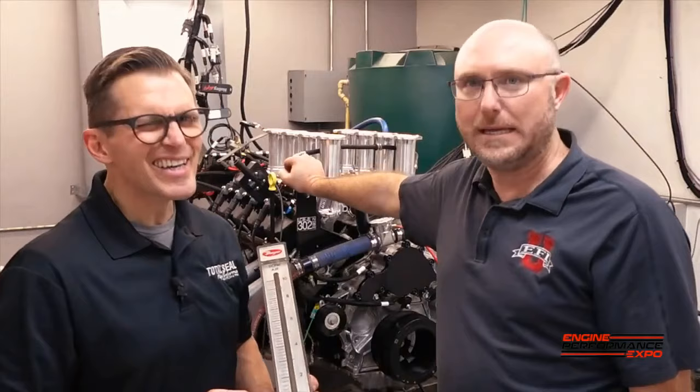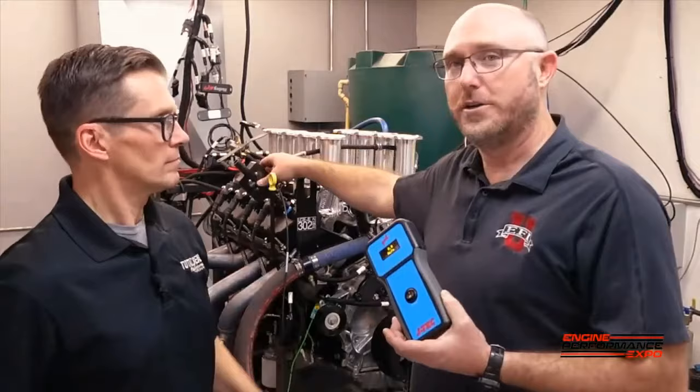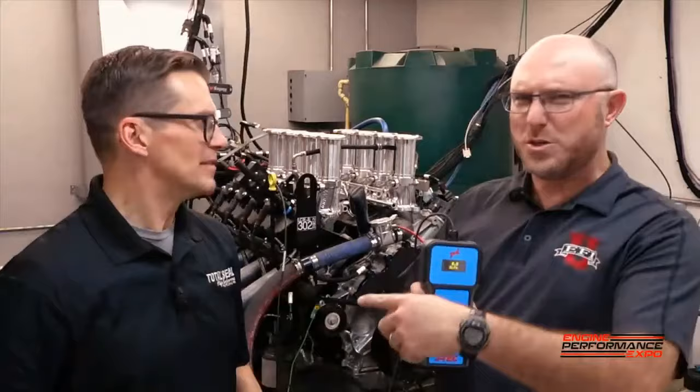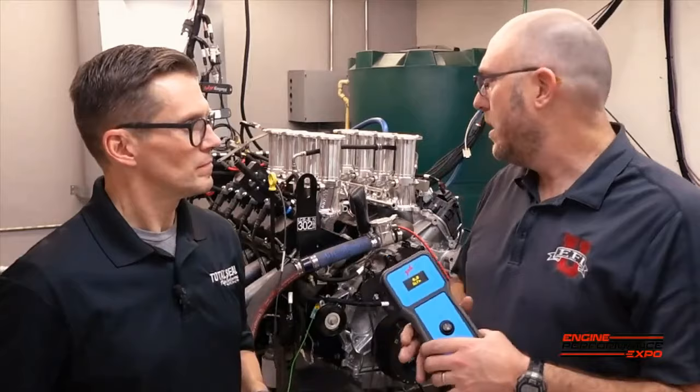So we got a more modern approach now with the JTEC meter. It's really the same thing — we've got a flow tube over here, just like your mass airflow sensor, and it just spits out a number. So now we can plumb this thing up, hang it in our window right there, and rather than squint at the ball and guess, now it's just a number in CFM of blow-by. Take a brand new engine, take a worn-out engine, and start making your database of how much blow-by there is.